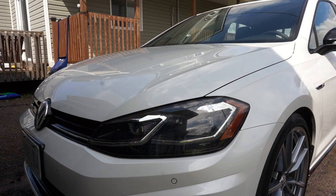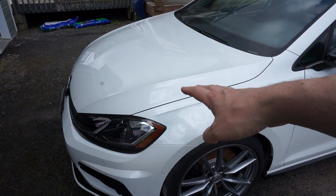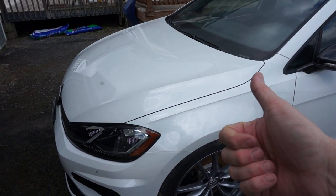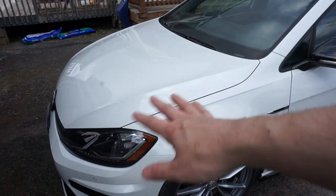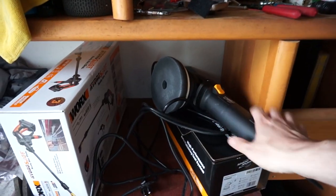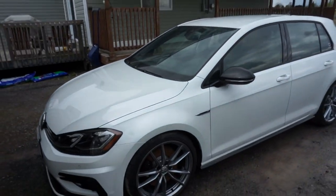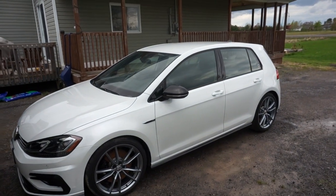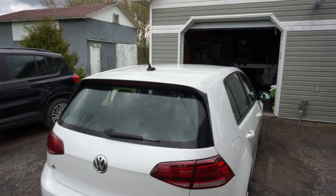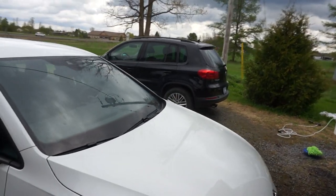Just going to keep doing the whole car like that. The hood is now done, and it does look definitely cleaner and shinier with a very light polish. I was doing it on Speed 2 — lightest pad, lightest compound, Speed 2. Very light buff of the hood. Looks great. I then have to erase off the polish residue before I can ceramic coat. The polishing step is now complete — that went very easy. It's the lightest kind of polish possible and it did polish the whole car. It's threatening to storm right now, but overall the car did buff up even nicer than it was before. Now I need to use the eraser on it, strip off all of the polish, and then it's ready for ceramic coat.